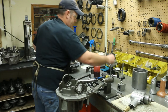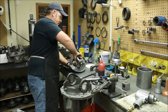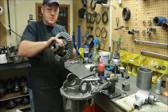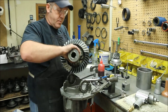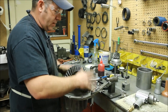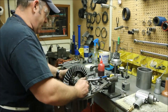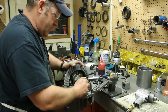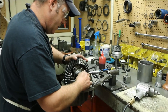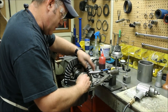It's really awkward whenever you're trying to drop a carrier group down into something that's too close. Whenever you go to drop your carrier group in, what I like to do is grab the entire thing, pick it up, and make sure that the races are with the part. I'll hang on to it with my pinky and my finger. Then I'll set the entire thing down in there, and you do have control. I don't like to drop anything — if it bounces, the bearings can fall out. Do a quick check to make sure everything is lined up, and then we will install the caps and torque everything down.